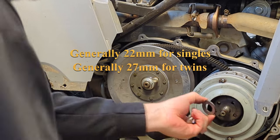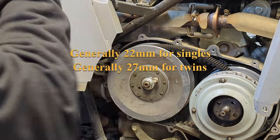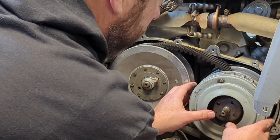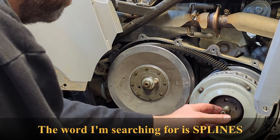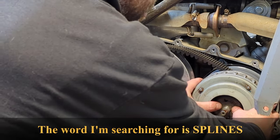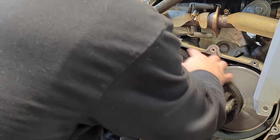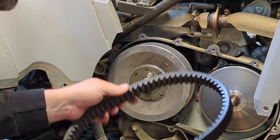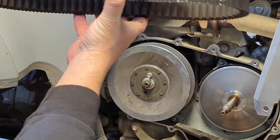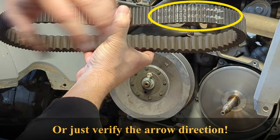I always start with the primary. Pop that bolt right off — you will have a bolt and a washer, don't lose that, keep those to the side. Do not cut yourself on this plate; it's very sharp. Take a look at the distance or the amount of teeth sticking out on that shaft and make a mental note for when you go back on. Now pop this belt off. Always pay attention to the direction it comes off — when the belt goes back on, we don't want to flip it. Make sure you remember the lettering on the belt and know which way the letters face.